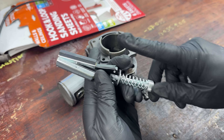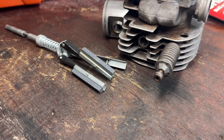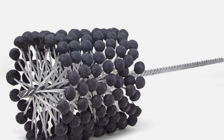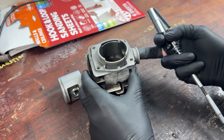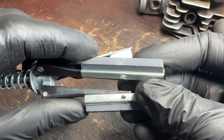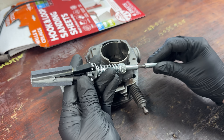You may ask yourself: what about using a stone hone or a ball hone to remove the transfer? My recommendation is stay away. You're going to cause more problems than you solve. The ball hone is going to destroy the thin plating very quickly, and the stone hone is going to fill up with the aluminium transfer. Neither are effective, neither are a good way of doing it. It really is a case of slow and steady wins the race.